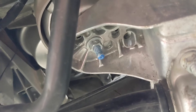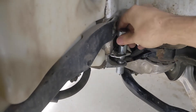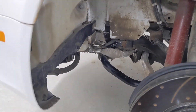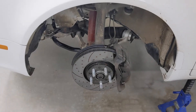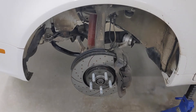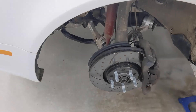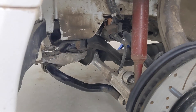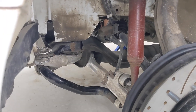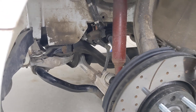With the jack removed, the motor mounts are now sitting firmly down into the brackets, so we can torque down that 13mm nut to 18.5 foot-pounds. And just like that, the job is done. Next time you go for an alignment, they should be thanking you for doing this project. This isn't the sexiest project of all time, but I really like doing these little things. You can do it in a quick afternoon, and it's these small incremental changes that make your car just that much better. I actually have a project coming up on the B7 that has something to do with the subframe — I'm going to be bolting something to it. If you want to know what that is, consider subscribing and join me next time. Thanks!